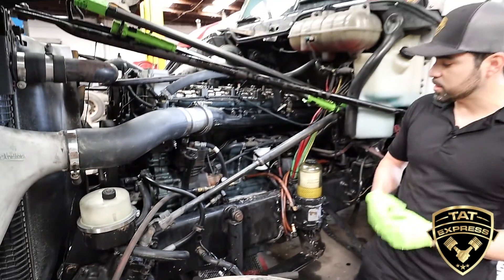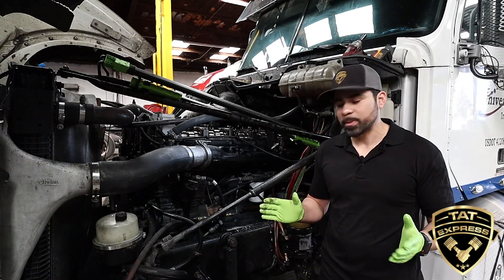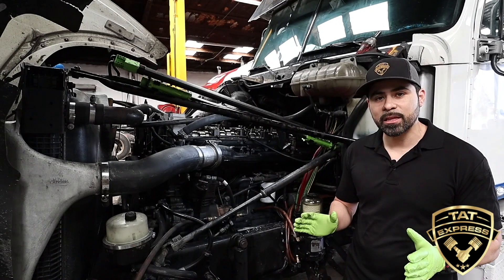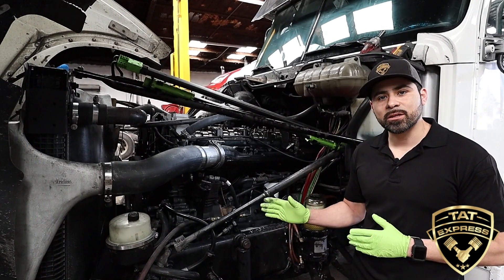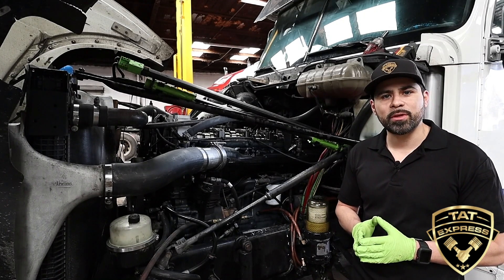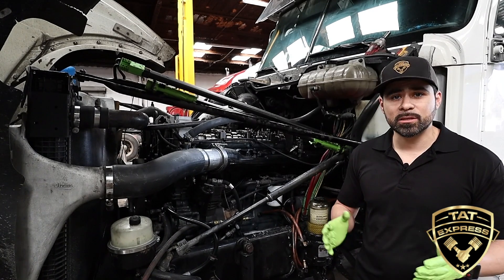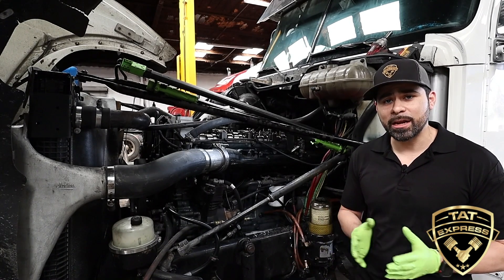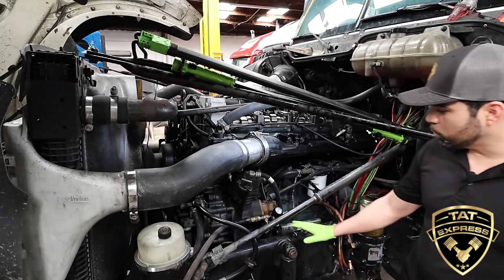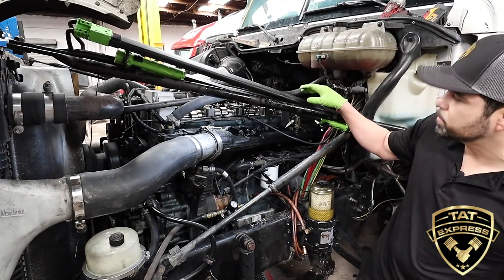Since I have it plugged off already, we're going to add 80 pounds of pressure — we're not going to add anything more than that. These 60 series only run around 80 PSI of fuel pressure, so you don't want to go above that. If you go above that you can actually create a leak — you can bust an O-ring if you go over 80 PSI. I have the gauge hooked up, regulated to 80 PSI, so we're going to go ahead and add air to the system.